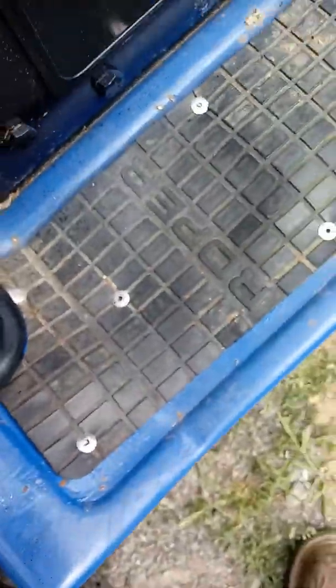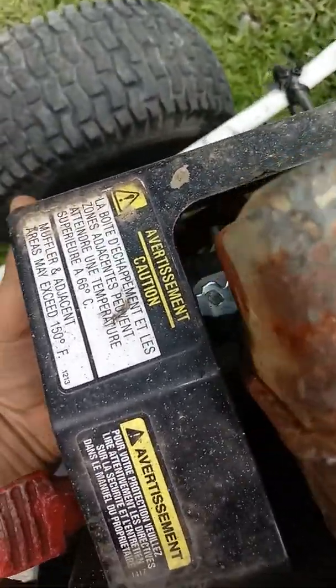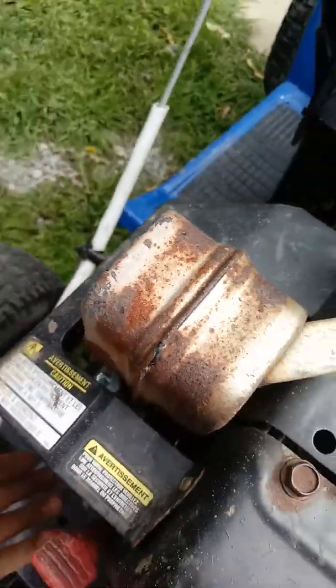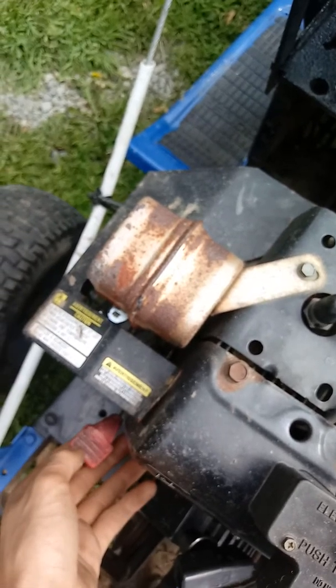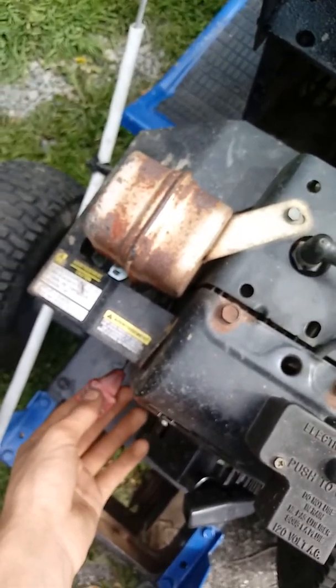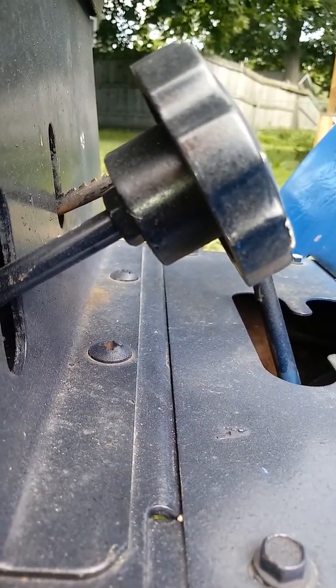Just beating the piss out of it. That thing came off so I just put a ton of pop rivets in it — holds it pretty good. We'll give this a start. The primer is down here, just hooked up with a little tiny hose. Then choke. It runs pretty good. What you heard bang is these notches on the parking brake need to be filed down and re-grooved — they keep just popping right out, which is kind of annoying but what can you do?